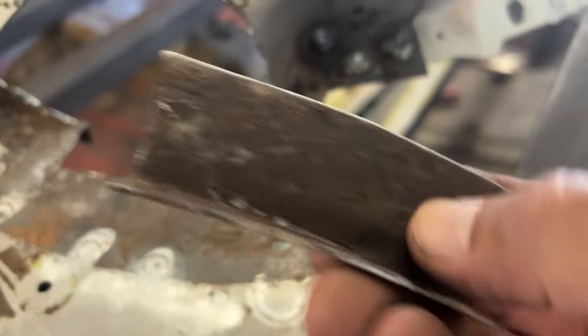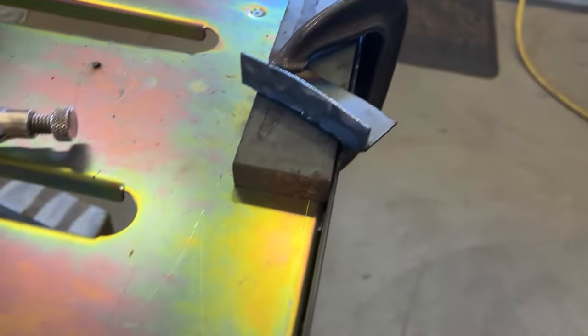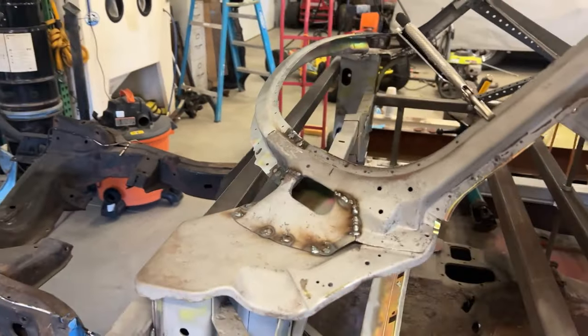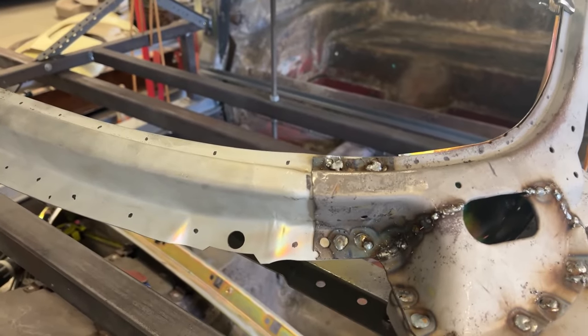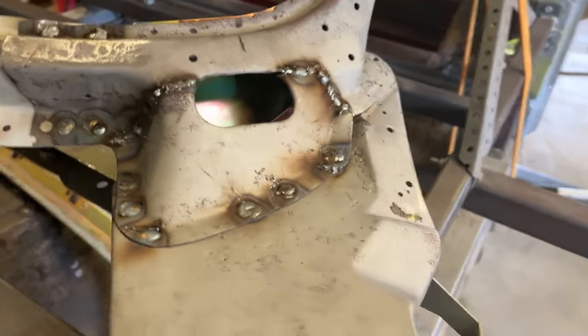I cut this piece out — as you can see there are a couple of pinholes. I didn't want that in there, so I cut it out to solid metal and fabricated a new piece to slide in. I'm going to let it cool off. I did get the lower outer window frame spot welded in to the two side arms at least. I've got to blend all those welds back out, but things are coming along good.